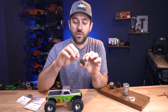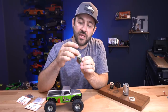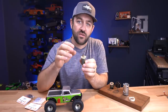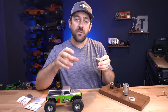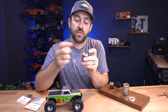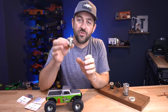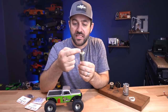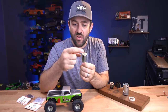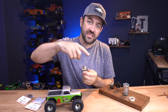The rotor has a number of copper windings around it and a commutator at the top. That commutator is what interacts with the brushes — that's why it's called a brushed motor. The brushes touch this commutator at the top. The combination of current flowing through the brushes into the commutator and then through the windings creates an electromagnet. As the rotor spins, the brushes go from segment to segment on the commutator, and that's what changes the poles and makes the motor spin.